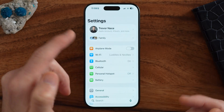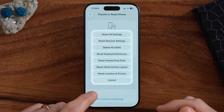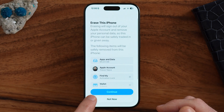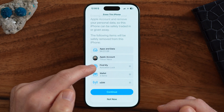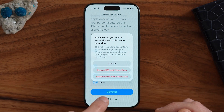After we've done that, it's straightforward to reset your iPhone back to factory default. All we need to do is get to 'Transfer or Reset,' and then you can see it says 'Reset All Settings' — that is one option. But if you're giving away your phone and want to remove all of the content as well, you can tap on that. It says it will erase this iPhone — it will delete the apps, your Apple account, Find My, wallet items, and your eSIM. Just hit Continue and hit 'Delete eSIM and Erase Data,' and this will bring everything on your iPhone as if you just bought it from Apple.